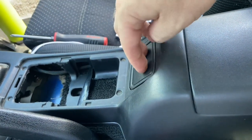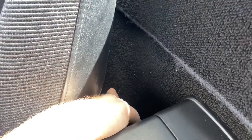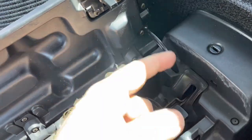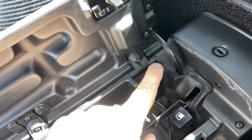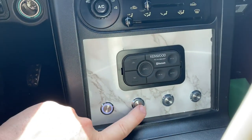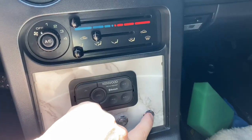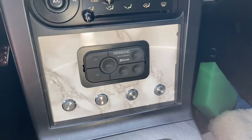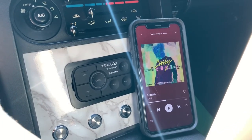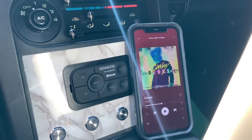The harness goes down along here and around, then back down to the fuse block. The reason I went that route is because this hinge part swings back down in there and it's a huge pain to maneuver wires around. Here's the switch panel all installed with the radio controller and four switches — air ride, puddle lights, light bar in the front grille, and one for future interior lights. I'm going to record this to give you an idea of how fast it pairs. Hopefully YouTube won't get mad — it's the same song from Epidemic Sound, just playing through Spotify on my phone.